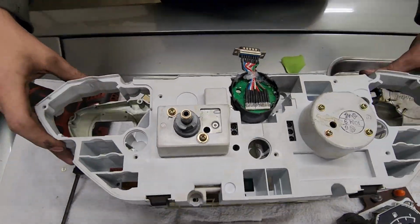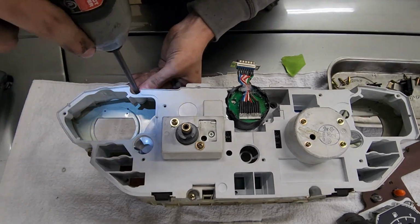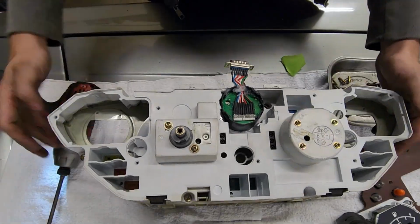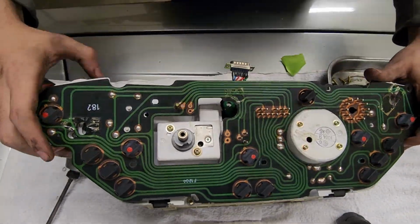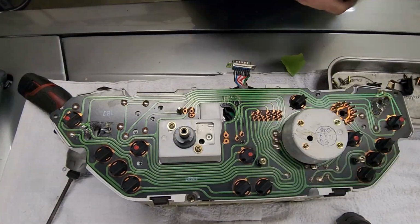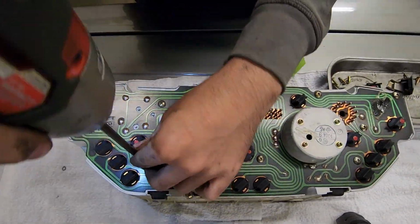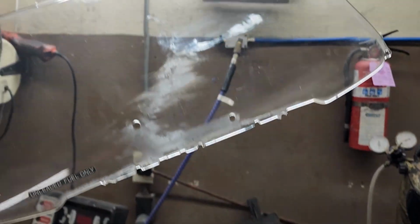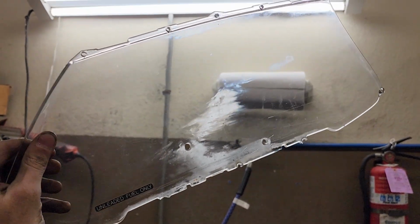Swapping the gauges over in both of the gauge clusters is very easy, as they are essentially modular in design, requiring no special tools other than a single size Phillips screwdriver. The reassembly process is also easy, but remember to be as careful as you can as to not break the needles off. Starting with the temperature gauge, slightly bend and twist the circuit board back into place, and firmly press the pins for the tachometer back into place as well. I also took this opportunity to polish the acrylic gauge cover and to remove the unsightly fuel warning sticker.